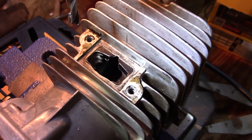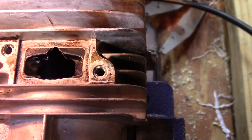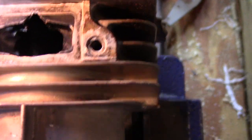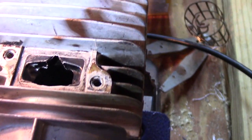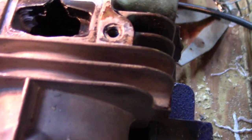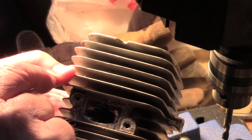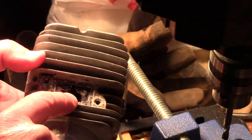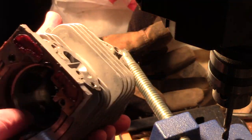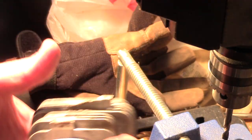So the chrome coating you have to be careful with — you have to bring the grinder from the inside to the outside. You don't want to try and push that chrome plating out. So I'm going to do some of the exhaust port porting. This is my setup: a little Harbor Freight drill press with a really good drill bit, just lightly touching the soft aluminum on the outside of that exhaust port. I just used a drill to clean up this port — there was a lot of material here. Just getting rid of the soft aluminum; I couldn't push through the chrome with this. I wasn't pushing hard, just trying to clean up the aluminum so I could clean up the chrome plating on the inside with a little die grinder.